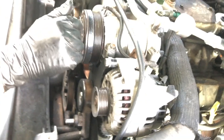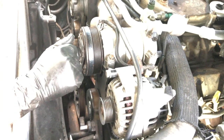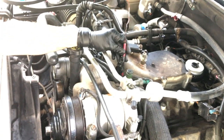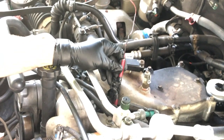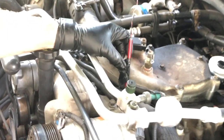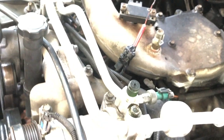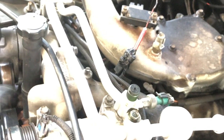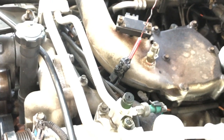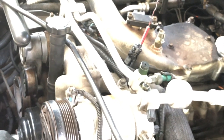We still have to do what's called a top dead center offset adjustment because we changed this crankshaft position sensor. The other thing I'll show you up on top is get yourself something that you can fish out and run the connector up where it belongs in the same spot as the old one, right up here, because it's a very tight fit, so you want to have it route the same way. That's why I was trying not to take the old cable off. I was going to put a piece of fishing line or something so I could pull the new one up, but it fell through when it came off in there. Minor casualty, could have been a lot worse like we discussed earlier.